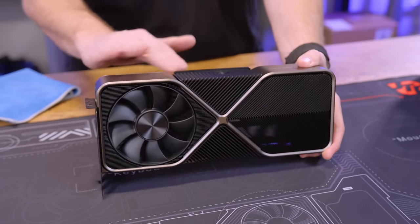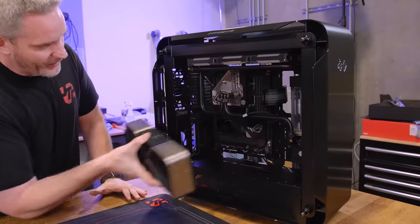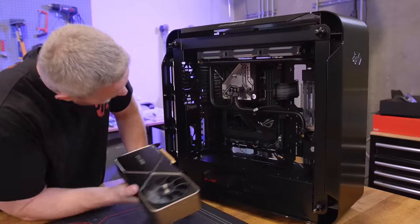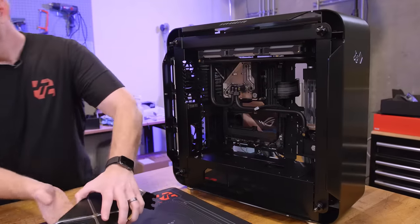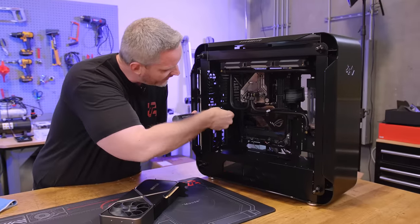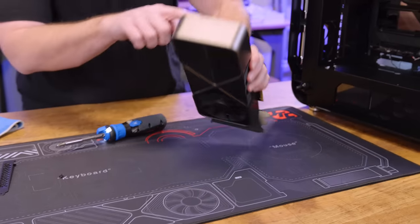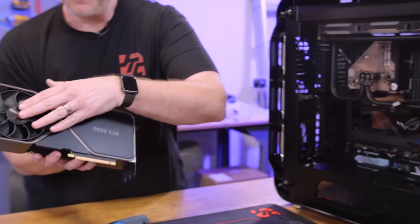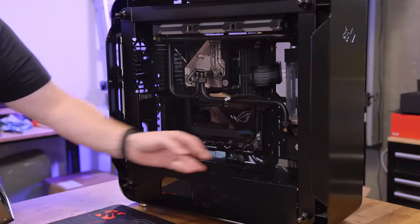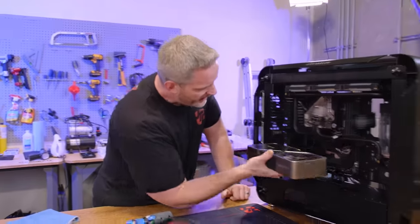A little bit of dirt there I need to wipe down. But remember, the vertical mount had it sitting in there like this, which is why it looks like it slots right in that spot — I built this whole system around the GPU. I'm curious now as to how this will look if I mount this in a traditional way because I never did that with this case. I think there might be a cooling benefit to having it horizontal rather than vertical, because all the air this fan pulls in blows through and out right here. Technically it pulls the air through — so with it sitting right there, that fan is just blowing right into that wall, which is not the most efficient because anytime the air has to make an abrupt turn it loses velocity. So let's see how this looks.